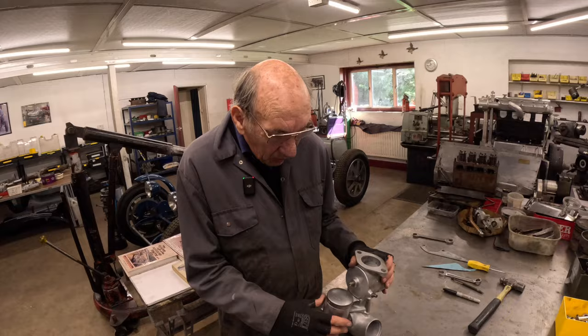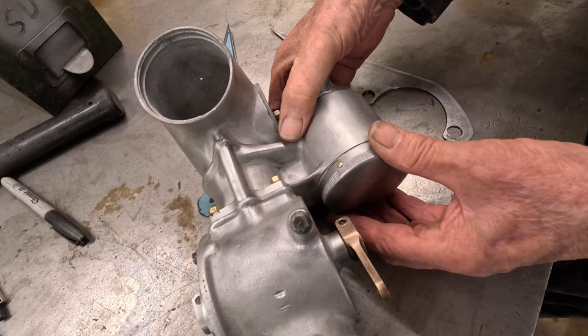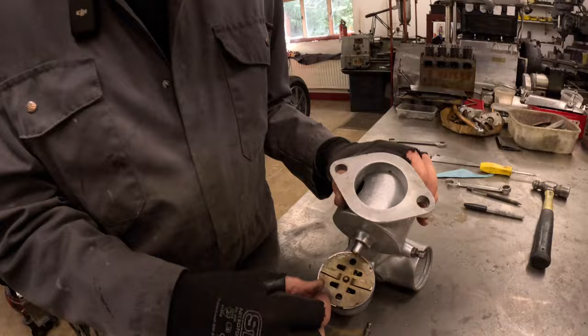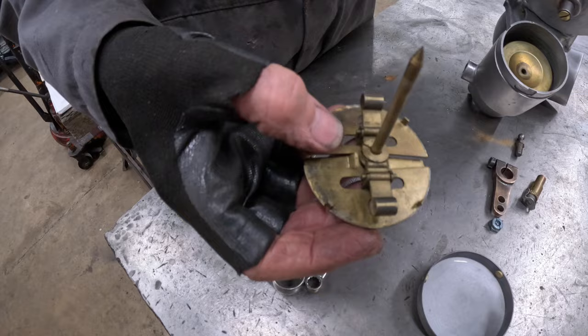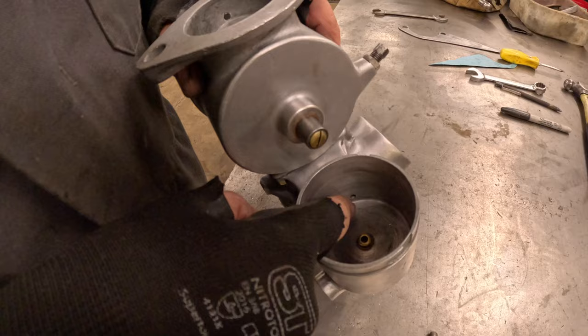Another really good thing — this tin cover, but underneath there is the mechanism for letting the fuel in, the float bowl and everything. On a racing car you've got to raise the float level, so you're in there every five minutes. What they've done is made it so you push it down and turn it like a light bulb, take that off, pull that out and there you are. Luckily this is in absolutely fabulous condition — it's never done anything. There's the float, which is absolutely beautiful, and two holes to take the fuel to the jets, one each side.